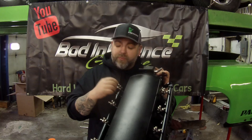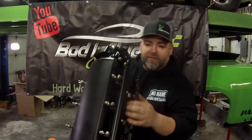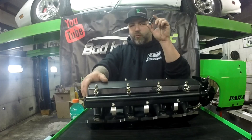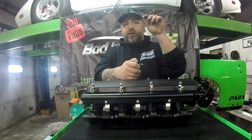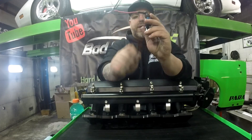We're using the soft-line system like we did on the Camaro, and I'm hoping to get the solenoids mounted underneath the intake. We'll need to make new brackets for the fuel rails — this intake is meant for the factory LS1-style injector, but we are converting to an LS3-style injector. This is actually a factory Camaro LS3 injector, flows roughly 42 to 45 pounds. We will flow them in-house. It's an EV6-style connector so we'll be changing the harness — no little adapters, we're doing a proper changeover.